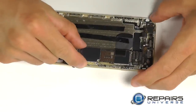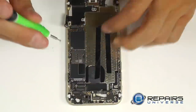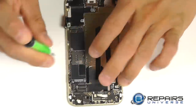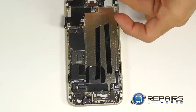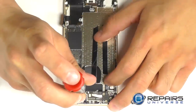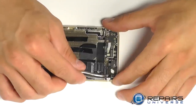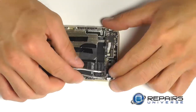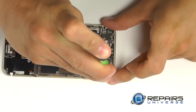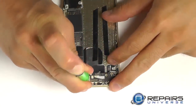Let's now maneuver the motherboard back into place, working our way around the ribbon cables. We can begin securing it with the Phillips screw down by the SIM card tray first, and then our standoff in the middle of the motherboard — remember we have to use our flathead screwdriver for this one. Remember that little strap by the rear-facing camera we mentioned previously — we can install that right now, positioning it into place and securing it with a single Phillips screw down at the bottom of the strap.